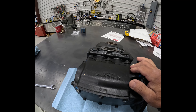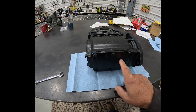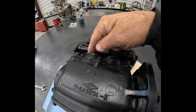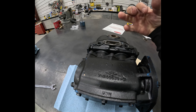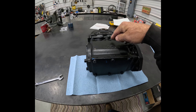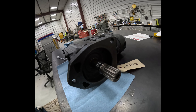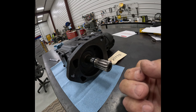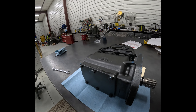Rather than send this clear back, I'm going to take the gasket crankcase cover off. I'll have to undo the rods, take the cylinder base bolts off, lift the whole assembly up, turn it around, and put it back in. They are going to send me the two gaskets needed to do that. One concern is that I think it's been sitting on the shelf forever, because this grease, whatever they put in there, is hard as a rock. So when we get it open, we'll see.